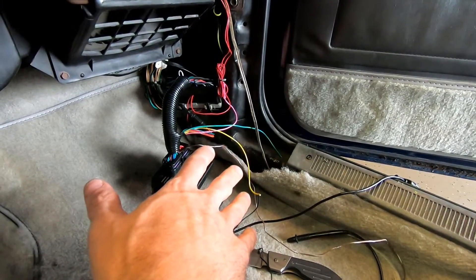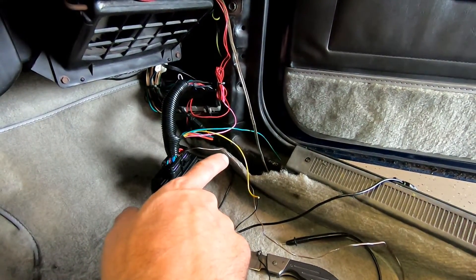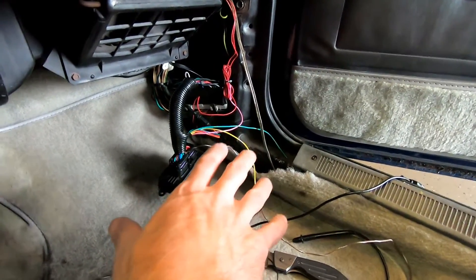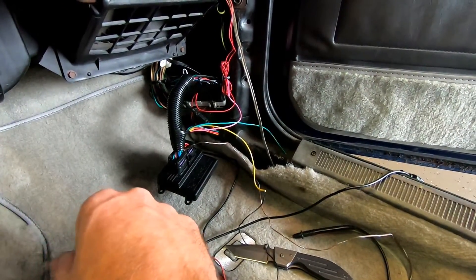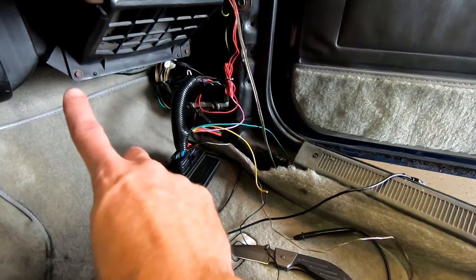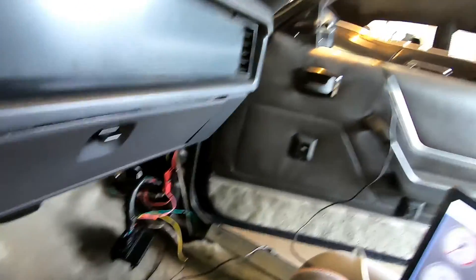The one option that comes with the kit is a yellow and white wire for the fan output. You can use this for a fan, obviously, but what it does is trigger a 12-volt power source, determined by the software when it clicks on. Mine already has a manual fan controller hooked up that came with my flex fan. So I'm just going to use it because it's functioning — it kicks on at 180, it does exactly what I want it to do.